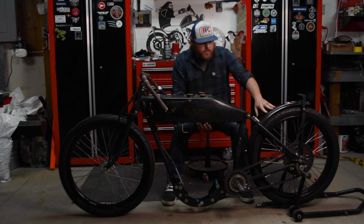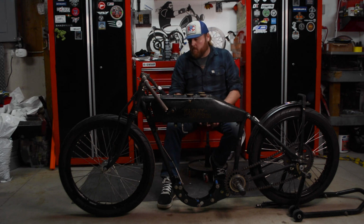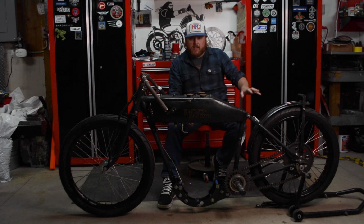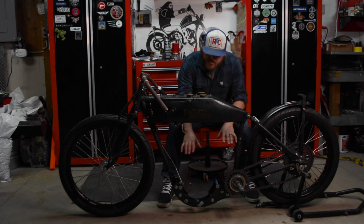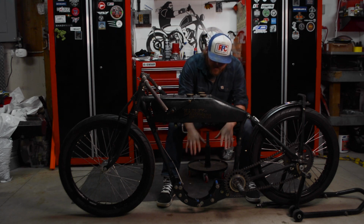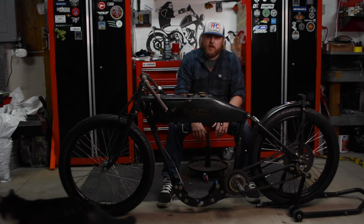The tins are going to be painted, and the rear fender. The chassis itself is actually pretty dialed in. We're going to run the setup that you're seeing here, but we're going to make some changes to it. We're going to go over the bearings, that kind of thing, just make sure everything's okay. We're going to be laser cutting some different cradles for the Keystone chassis portion. This actually holds the motor into the frame, and it makes the motor a stress member.